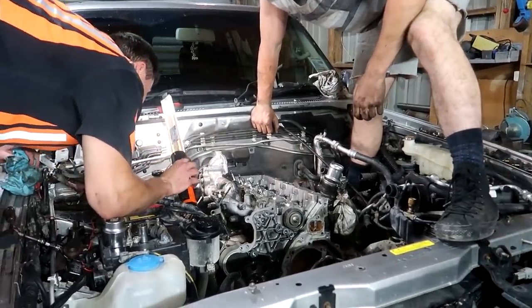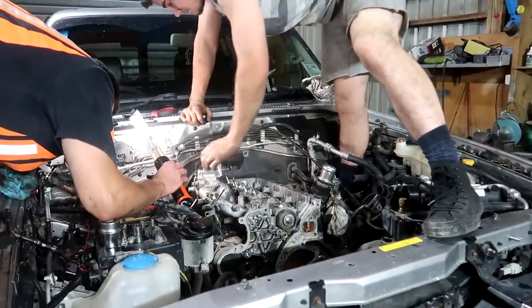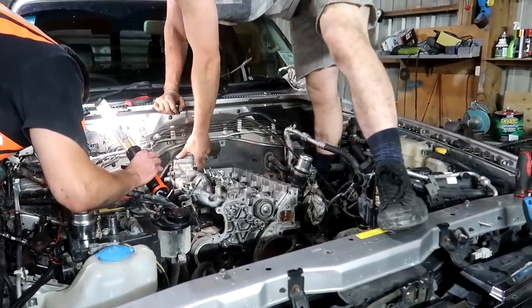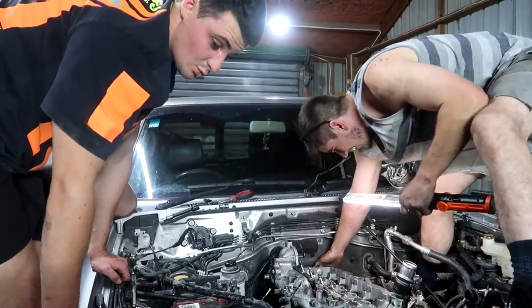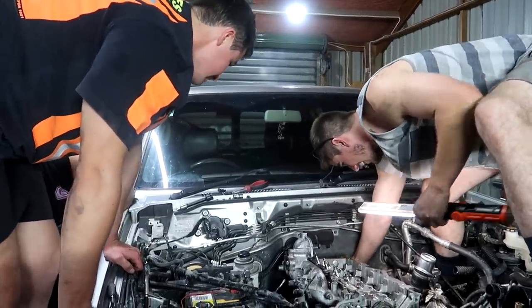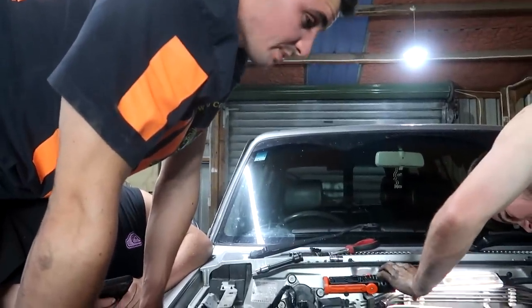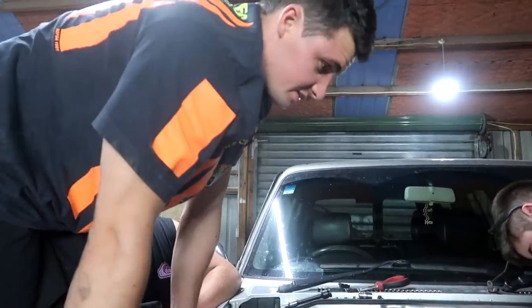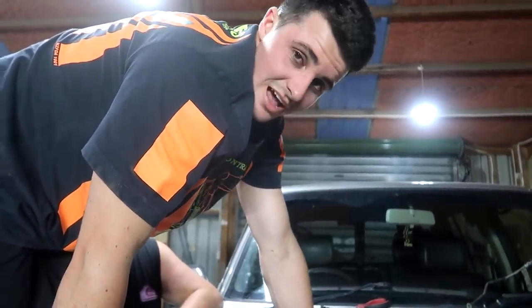Here give me a look - you lift up. See what that hose was connected to the head, so I undid the bolt. It's a long reach when you're down there when this thing's 20 feet up in the air. So what's happened - these two bolts at the back, it's actually a head drain, right at the back of the head. They put it on this when it probably doesn't need it, but they don't put it on the RBs.